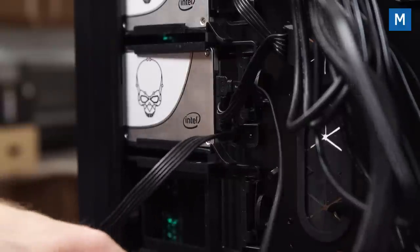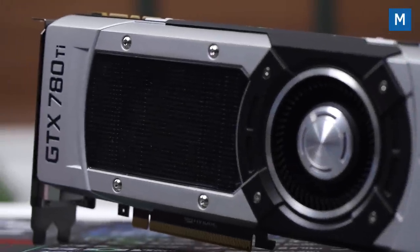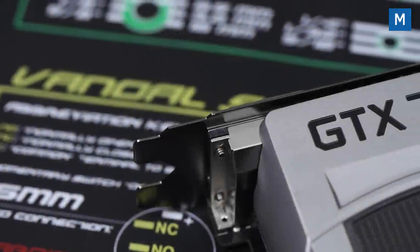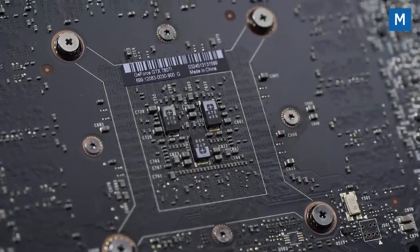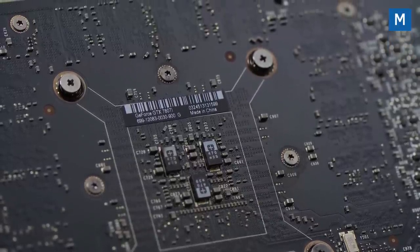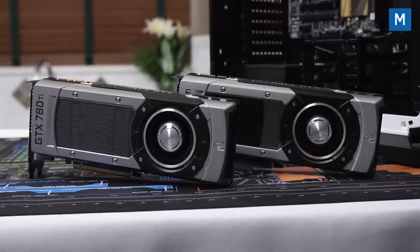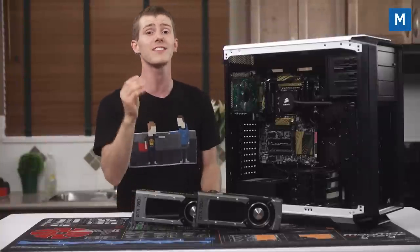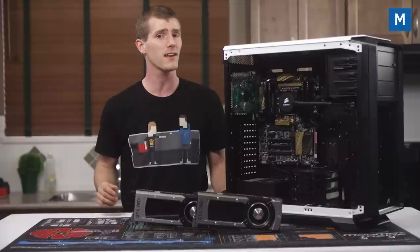Our GPU choice of dual GTX 780 Ti's for a 4K gaming rig is likely to raise eyebrows. I'm not a strong believer in 3- or 4-way configurations — the scaling doesn't justify the extra cost, heat, and power consumption. This dual-card config will run even the most demanding games at medium to high settings at 4K. While I can tell the difference between high and ultra in screenshots side by side, when things are in motion I don't find it easy to tell, so I won't spend more money to turn that dial higher. At this pixel density, I don't find anti-aliasing very useful beyond 2 to 4X anyway.